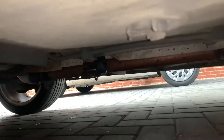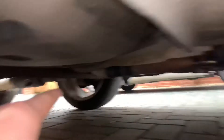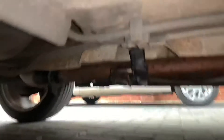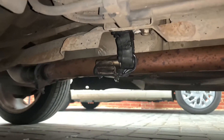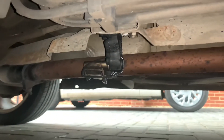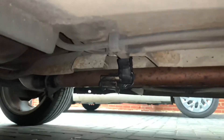So as you can see we're under the car. It's been lowered so it's kind of hard to get under it, but I don't really want to mess about with the jack. That's the back box there, that's the middle pipe. I've modified the back box. We changed both the mounts about six months ago and now this one — it's held on by cable ties at the moment. You can see where the rubber's kind of perished. I don't know why that's happened but we have to change it.